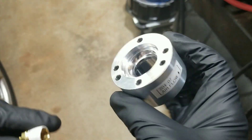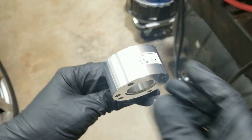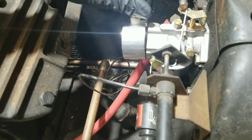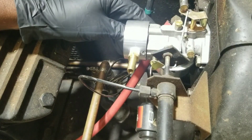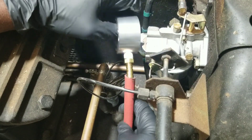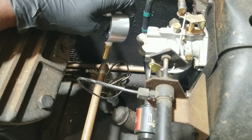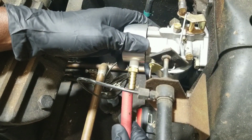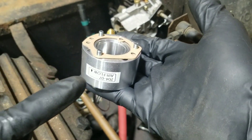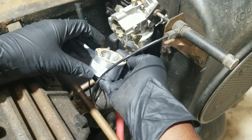This is the adapter that goes right behind the carburetor. The airflow goes this way into the carburetor and into the engine. This is the hose barb fitting adapter. I'm going to screw this in and mount it to the back of the carburetor. I tried to put it on the carburetor where the gasoline would have gone in, but the barb fitting on the carburetor is too small, so I'm going with this adapter. Once the screws are in and tightened, the hose will go here, along with the included gasket.